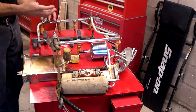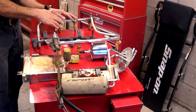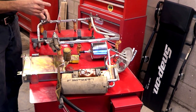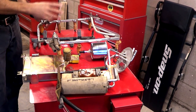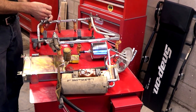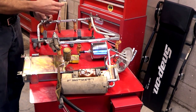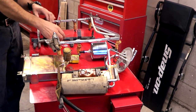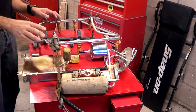Your car is going to have different demands. At idle there's going to be a lower demand for fuel pressure than at wide open throttle. That's why the regulator has a vacuum line — it maintains a certain pressure at idle, and when you floor it, the vacuum disappears. The spring inside the regulator overcomes the vacuum and the pressure goes up by at least another five pounds, so there's more fuel entering the system and it doesn't run lean. This describes systems that have a return line.